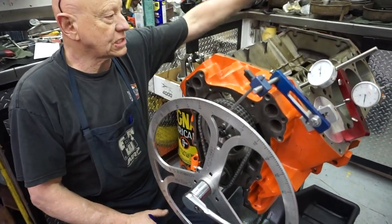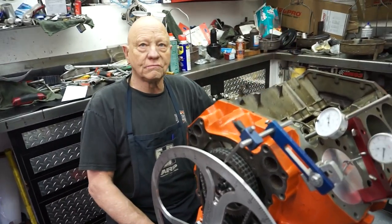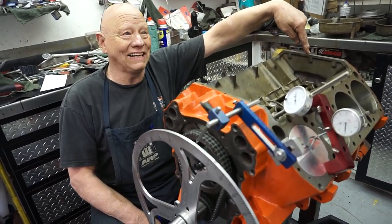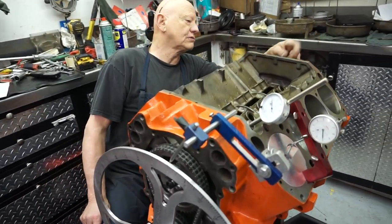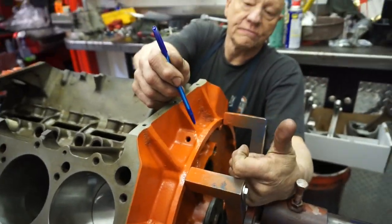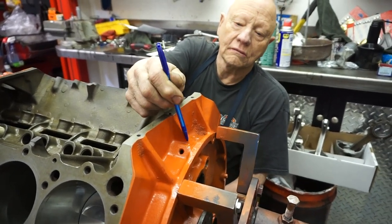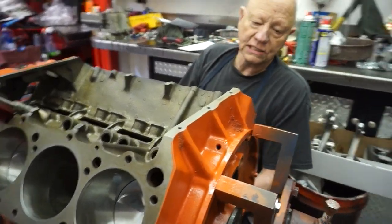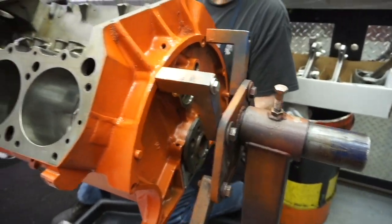If they were too far off, there's still so much pressure on it that it would eventually split the gasket and it still pooches out. And out the back side — I don't know how many guys put rear main seals in the motor because they're getting oil over the back of the motor. Well, you follow it up — guess what? The rear main seal is fine. It's puking out here and running down. And a lot of engines also had, like this one — that's where your oil pressure sender unit is. And most of them had gone to electric gauges by then. Well, that diaphragm in there ruptures, it starts to puke out here and down the block it goes — you think it's the rear main.